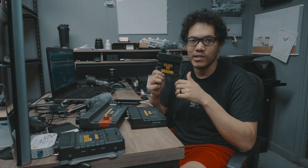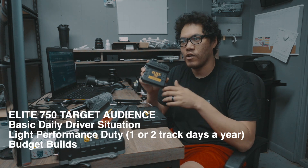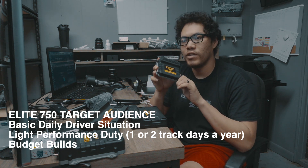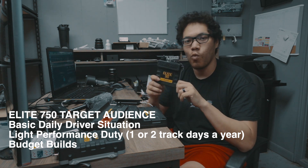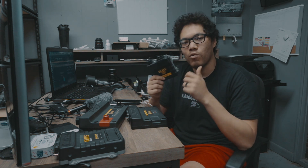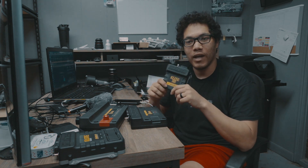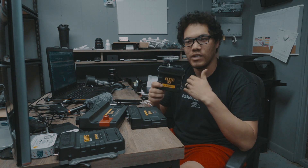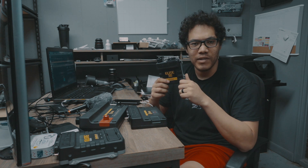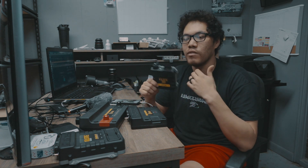When you start really using those extra outputs, I would recommend jumping up to the next ECU. This ECU is for your guy building a basic stock port or street port, 200 to 400 horsepower turbo build — it'll do everything you need. The big downside is that it only has one stage of engine protection and doesn't have a ton of I/O. It's really only made to run what the car has. Being a rotary, there aren't as many sensors or outputs as something like a Honda, so you do get plenty of I/O for most things.